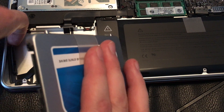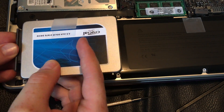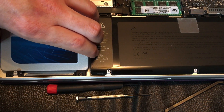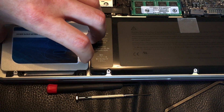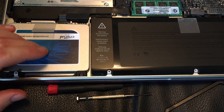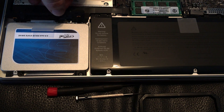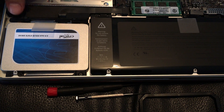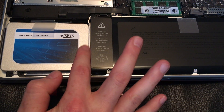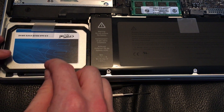The way it goes in is this way — it's pretty logical, you can't really put it another way because the connectors won't line up. Hook it up, put it in here first so it kind of locks in, then let go and you're good. All we have to do is the last part — put this guy on. Just remember: the last step is to put this spacer on, because this drive is a little bit thinner so you need the spacer that comes with it.